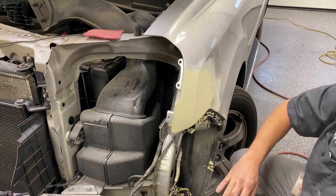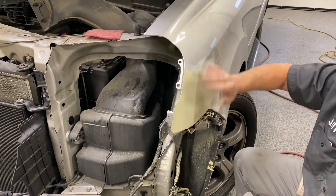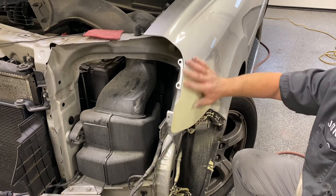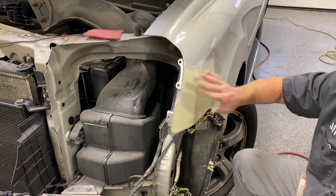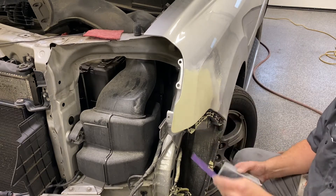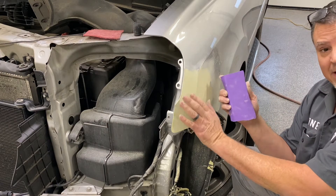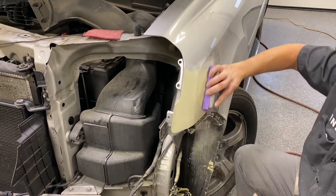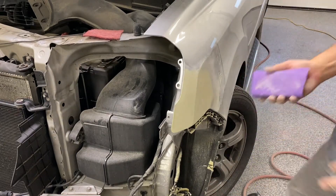Okay guys, I got this 90% straight and that was 80 grit. As far as the order of succession when it comes to grits and body filler, it's 80, 180, and 320. Some people start with 40 grit for body filler, but this spot was not big enough to need 40 grit sandpaper. So 90% straight — now I'm going to finish it up because these are all 80 grit scratches and we can't prime over those. We can prime over 180, but ultimately I'm going to end up with 320. So what I'm doing now is switching to 180. This isn't the normal paper I would use, but I got a ton of it and it was free. I'm going to hold it on the block and do the same thing I did with the 80 grit, and that's going to get rid of the 80, give it the final finish. Then I'm going to go around the outside and go to 320. I'll come back when I hit the 320.